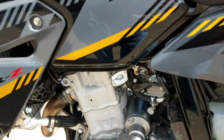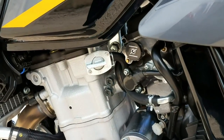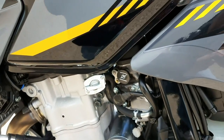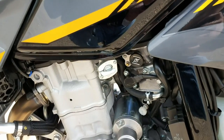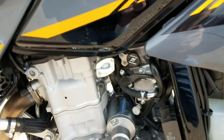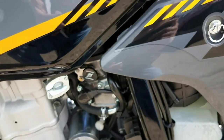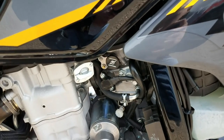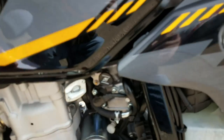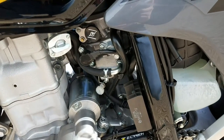Down here on this side, we got the Raptor fuel valve. Just got reserve, off and on. We've got long Wyoming winters out here, so when I park my bike, I like to know that the fuel is shut off. I'm not a fan of the vacuum ones. Plug the vacuum on the other side of the carburetor, and it's a direct bolt on with this Raptor one. You just reuse the stock spacer that goes up underneath here. It works great. It's $22.